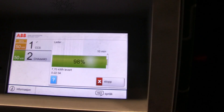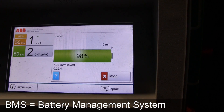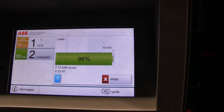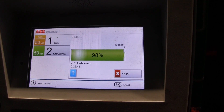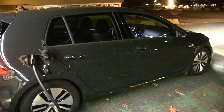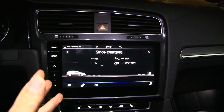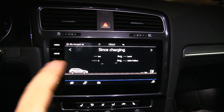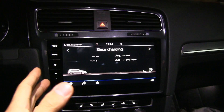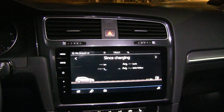The easiest way to find state of charge is to look at the charger. The charger gets info from the car's BMS, so it knows how many percent it is. The car tells you it would take ten more minutes to finish charging. We're at 100% now - we know by the sign of the charger - and the charger stopped very fast, which indicates we most likely have a buffer at the top. Usually if it really charges to 100%, it will take like half an hour to one hour, but here it was like boom, hundred percent, stop.